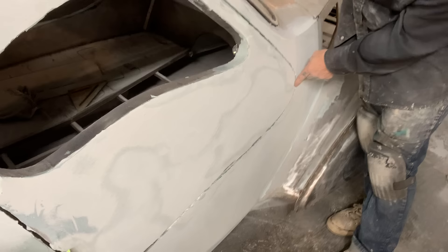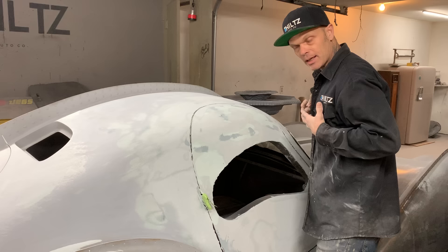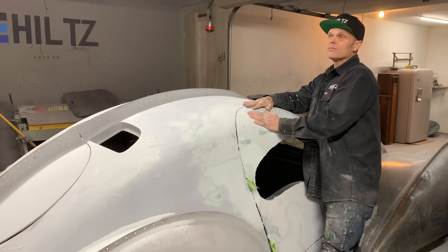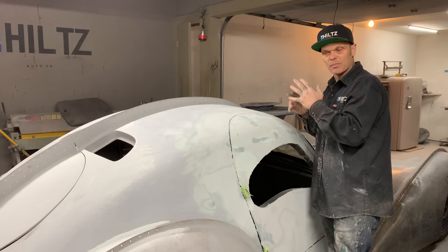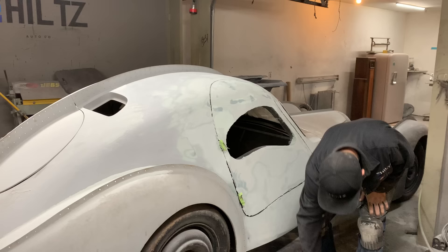I've got a little metal on the bottom of the door, a little metal at the corner, some metal up here. To get a show car finish, if you're building a car like I am or any car really, if you want it to be perfect like show cars are - 99% of them have been flooded with high build primer, urethane putty, polyester putty, or Bondo. The whole car has been flooded with that to make it perfect so you can sand it together.